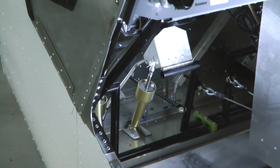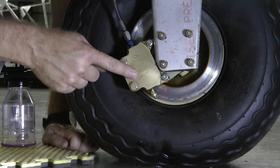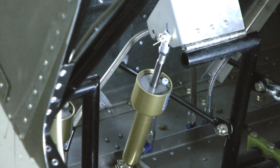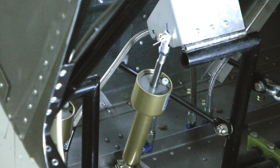Our system begins with the brake pedals attached to the master cylinder with a push rod, where pressure is developed in the brake line to operate the disc brake calipers at the wheels. This Matco master cylinder has a built-in fluid reservoir — this is the large bulge you see at the top. That holds the fluid that supplies the master cylinder, which is the part below the bulge. Your brake system might have a separate reservoir and master cylinder design.